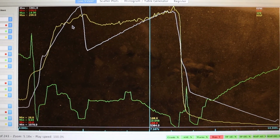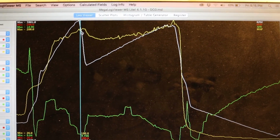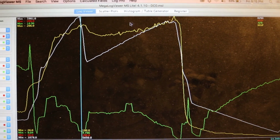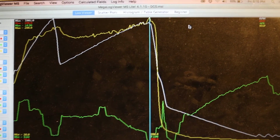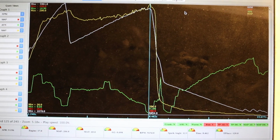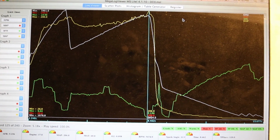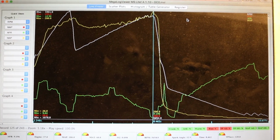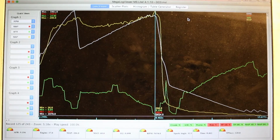And then here it is creeping on up to about 190 in first gear. Then it shifts and drops back down, and the highest I see is about 200 kPa, which is only about 14.5 pounds of boost. So I'm having about 4.5 psi of boost creep, which is manageable. If you were trying to run this eBay turbo with the cheap wastegate actuator and your car couldn't handle that much boost, then you'd have an issue.